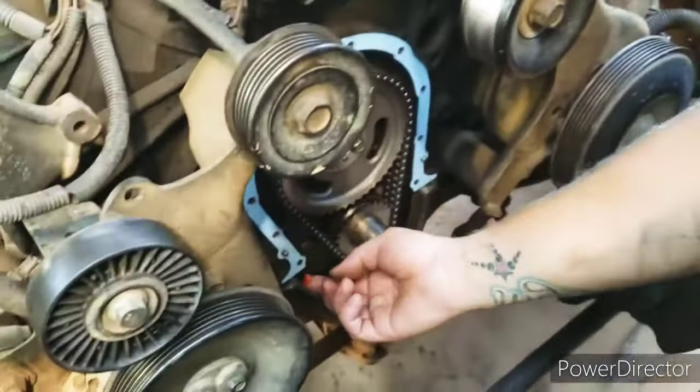It's the next morning, and I got the oil pan off last night. There wasn't anything in the way. There's no marks, there's nothing hanging out in the middle of the assembly. I rotated the assembly around by hand, and nothing got in the way. So then we turned it over with the key, without the fuel going on it, just to see what it was doing then, and you could hear the knock. It has a rod knock. It does sound like it's in the back of the engine, like it's one of the last two rods, or possibly something making a noise with the torque converter or transmission.